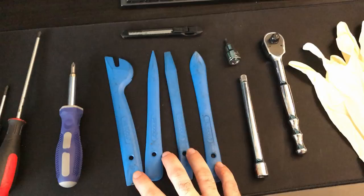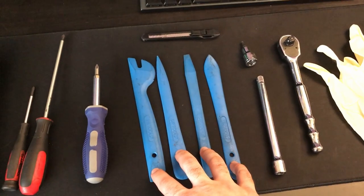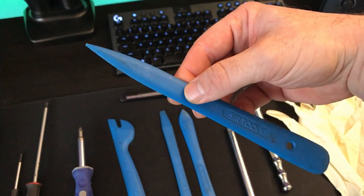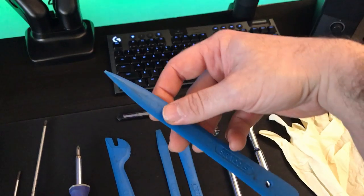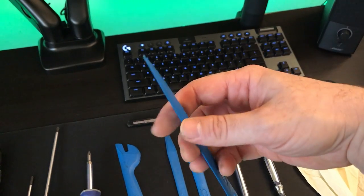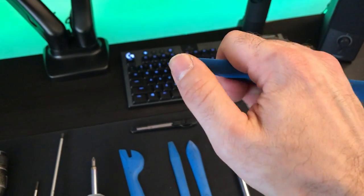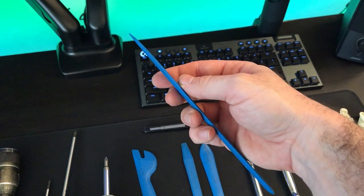These were the key for me to removing the stock bracket for the CPU cooler — they are plastic pry tools, basically used for automotive to remove interior panels. I found the skinny one to work the best; it's just got a little bit of a tip to it. I was able to wedge this underneath and pop the CPU cooler out without damaging the back of the motherboard. Most people use a flathead screwdriver, which would probably work, but this is the safest because it is non-marring. I'd highly recommend getting some of these — I'll link them in the description.